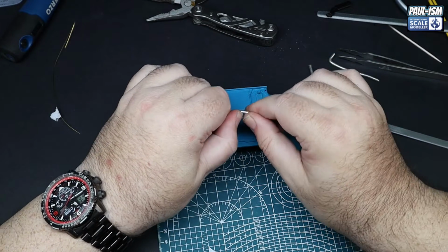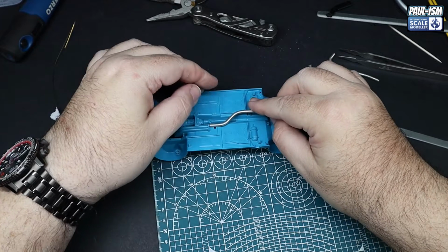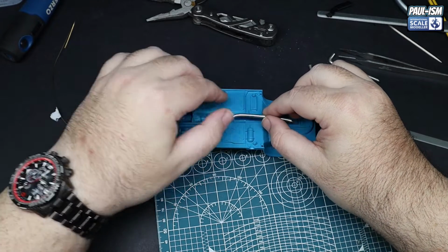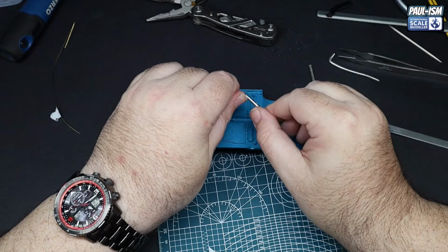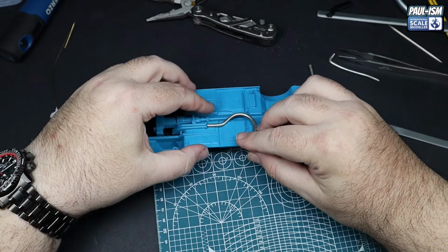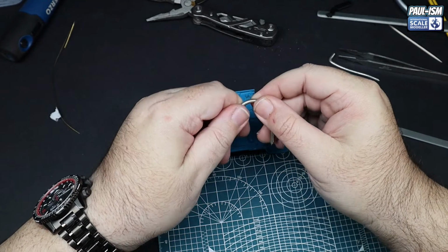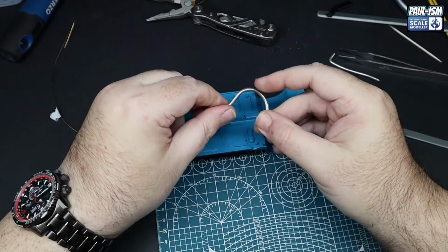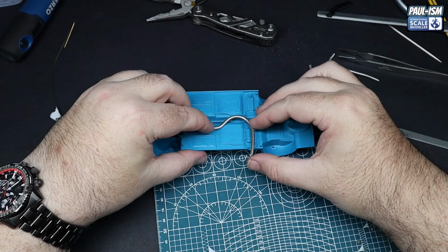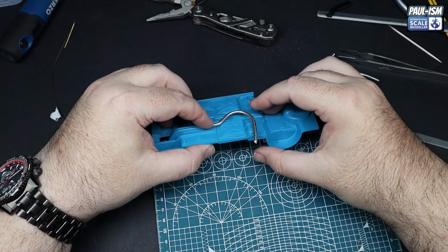Underneath this car, on the touring car, that vessel there at the bottom, I think it's like a fire extinguisher or something, I'm not sure what it is, isn't there on the touring cars. I have pictures of the Labatt touring car underneath, and that is not there on them. So sadly it's a hollow part as well, so it's not easy to remove. So I've opted to leave it be. We're going to hide it under the exhaust as much as we can. We're not going to paint it to draw attention to it. We're going to work our exhaust around it and kind of use it as a mount for the exhaust.